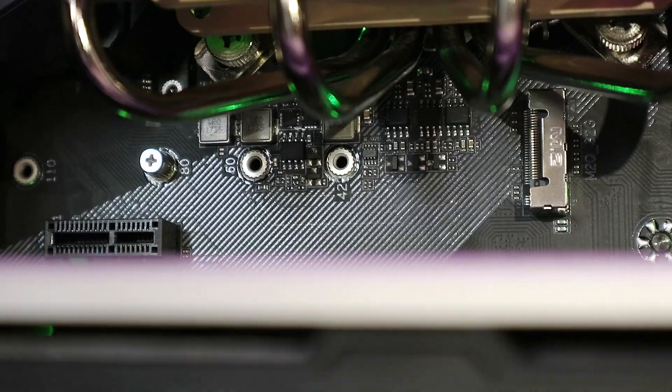The next step is the BIOS setting. Before that, a couple of things to point out. First, I suggest you unplug all unnecessary connections just to avoid potential issues. Second, if you use the M.2 SSD, there are two M.2 slots on this Z370 Gaming board. The M.2 SATA underneath the graphics card shares the same bandwidth with SATA 0 on this motherboard, so if you do large data transfers regularly, performance may be affected — bear that in mind.